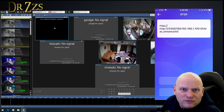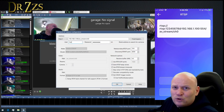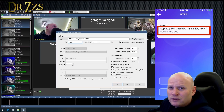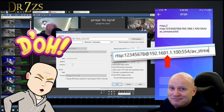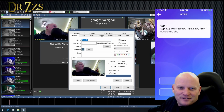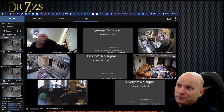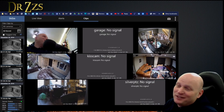First attempt failed to connect. The fix: if you type in everything you see after 'rtsp://', Blue Iris will put the username and password in the right place — 'rtsp' and '12345678' by default. Just make sure you don't have any typos in the IP address, like I did. Then hit OK, go to General, and we can see it's moving — we're in business! Back in the Blue Iris web server, visible on any computer in the house, the live view looks pretty dang good.